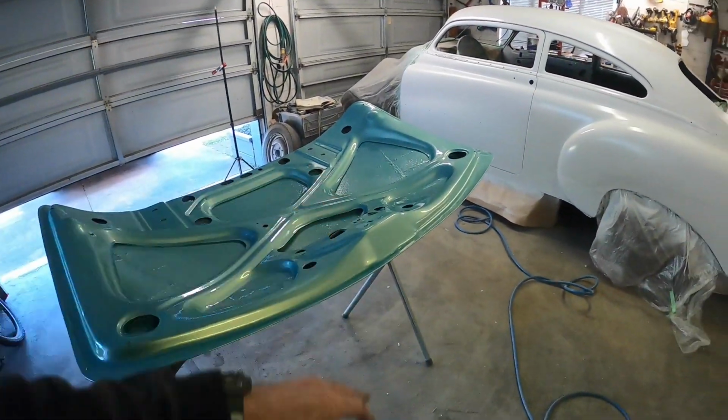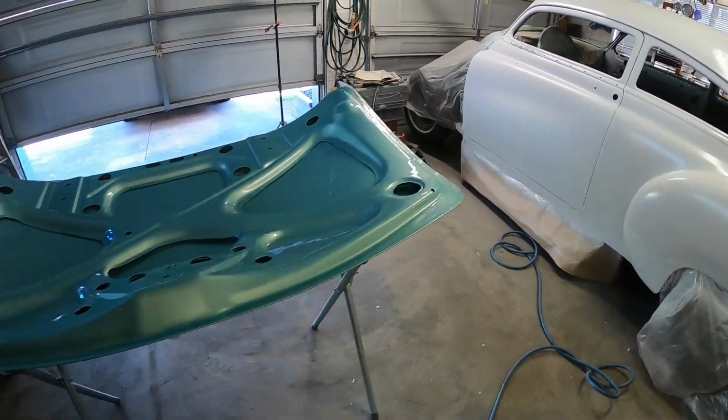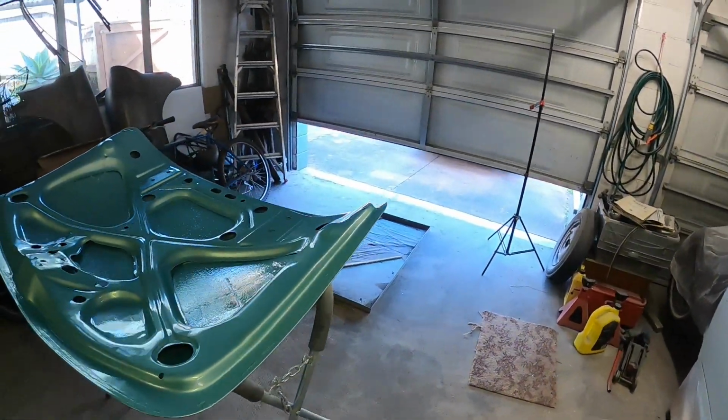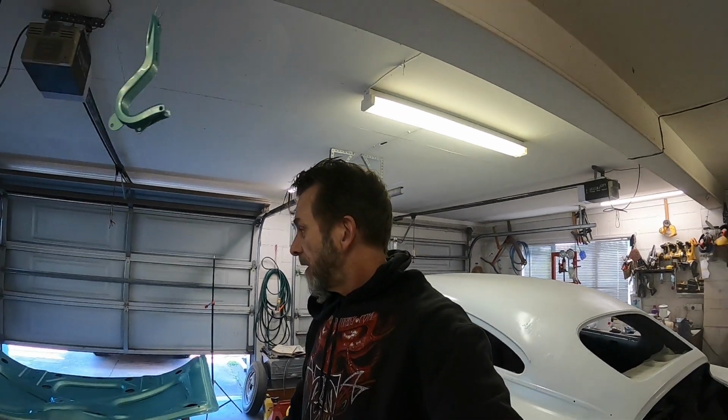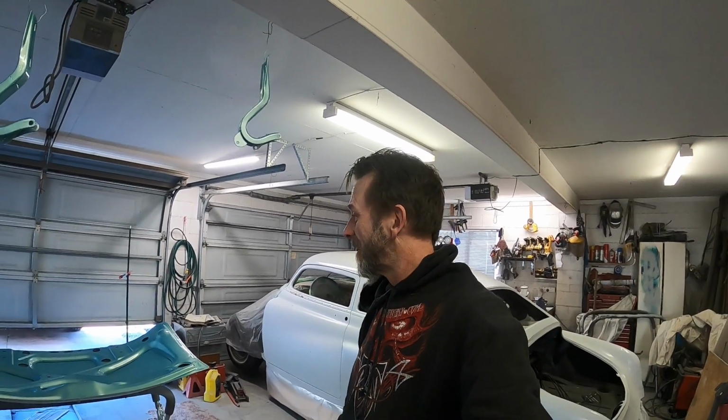I don't know whether I'm going too fast, too slow, but some of it is alright, and it is just under there. It's orange peely as all hell because I thought I'd put one heavier coat of clear on, and it just went on dry. It was mixed about 1 to 1.5, so that should have been pretty thin. Normally, with just lack of clear, I go 1 to 1, and on the last coat I'll go to about 1 to 2, one real thin coat at the end. It helps lay it out a little bit, but not this time. My god.